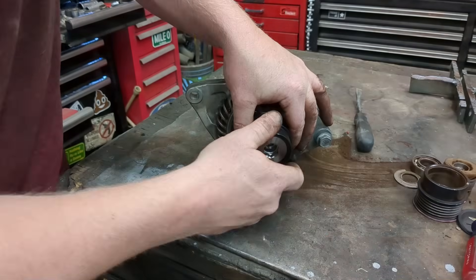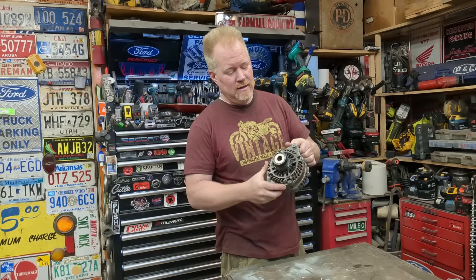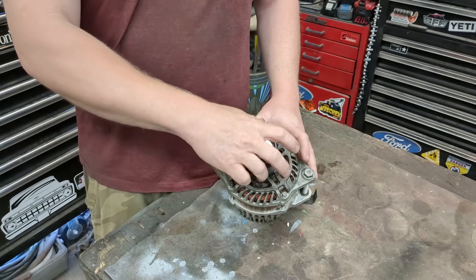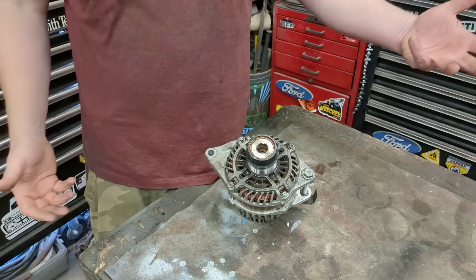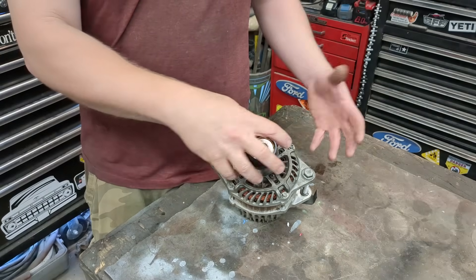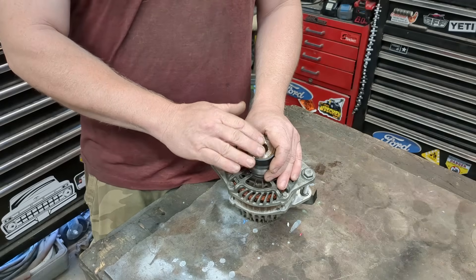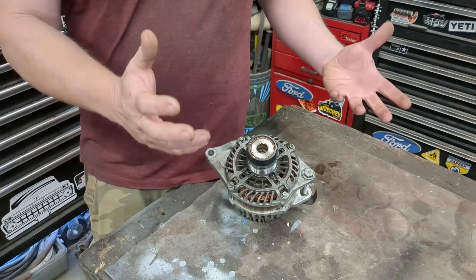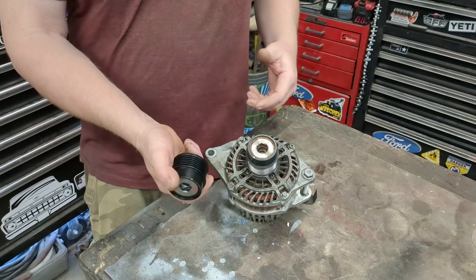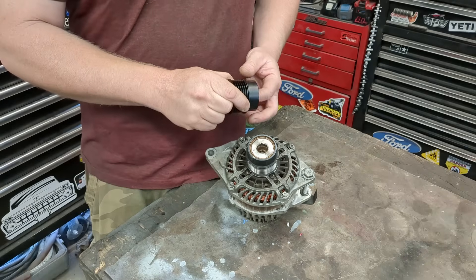You can see it actually overruns pretty easy. A $300 alternator is bad because the pulley on the front is bad. This right here is a decoupling pulley, and it doesn't matter — Ford, Chevy, Chrysler, Volkswagen, Toyota — everybody has been using these for the past 10 to 15 years. At first they weren't making replacements and you had to buy the whole new alternator. Now you can buy replacements for about $100, and I found this cheap off-brand knockoff for roughly $25 to $30.